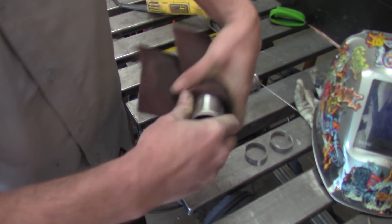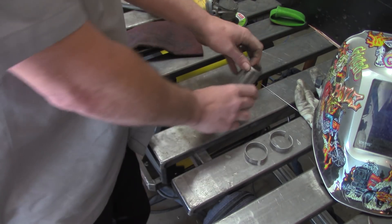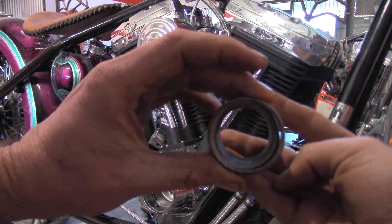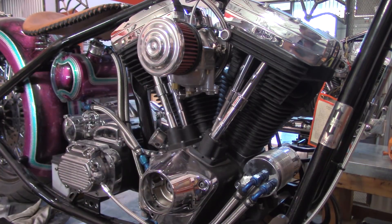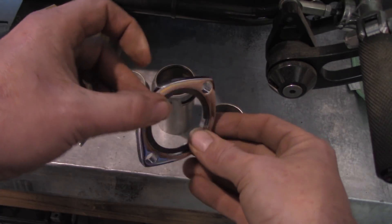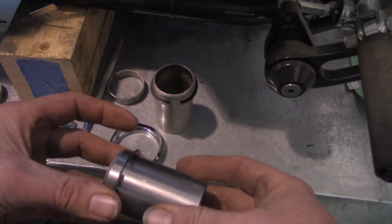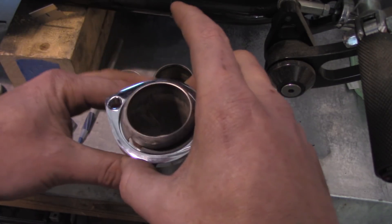Now, the final step here before we assemble it to the bike itself, I'm going to go ahead and take a surface prep pad, get it all nice and cleaned off, and it's ready to go. Now, let's take a look at the gasket here. You notice that it's pretty much a donut gasket — kind of like a graphite composite style with a woven mesh in it — but the inside of it has a taper on one side. When you set that up to the cone, you can see how it's supposed to sit in there, and it kind of moves and swivels just a little bit, and it's going to be compressed down. The way this essentially works is you have a split ring that recesses into the actual head flange itself, which compresses and pushes that cone or that taper into the gasket to seal it. So as soon as you put the ring on the outside of it and slide the flange right over top of that and slide the ring into the recess, you now have this ball and socket type of design that compresses itself and self-seals into the gasket.